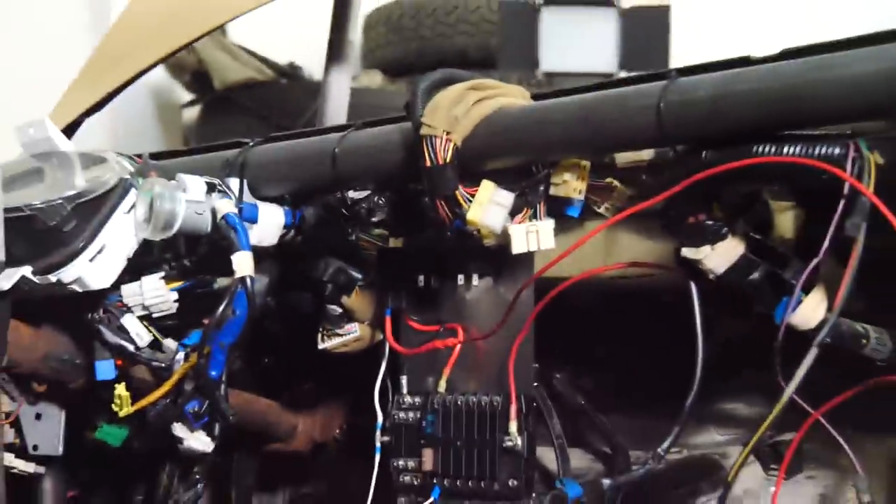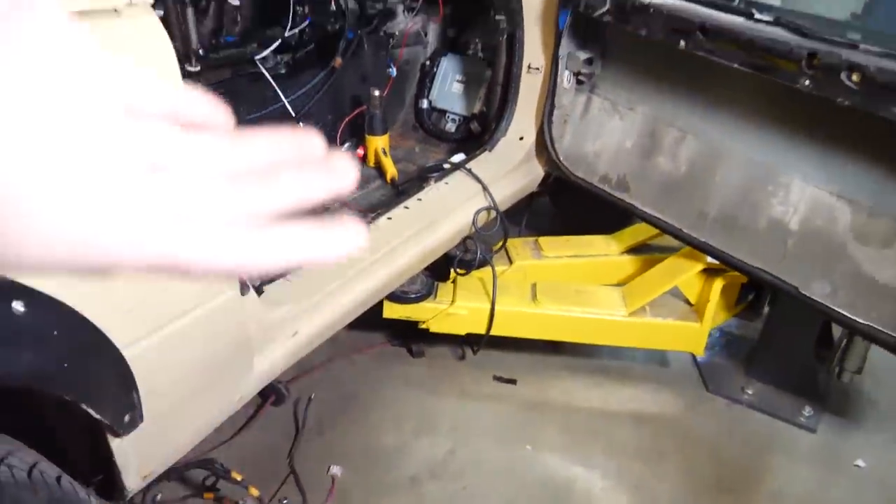Got the fuse panel mounted with relays for the fuel pump, the two fans, and the water pump. I started doing the wiring and then ran out of solder, so that's it for this video. Didn't get everything intended done, but a lot was accomplished — entire engine bay work is done, the radiator is mounted, some lines are done, and the electric water pump is mounted. In the next video we'll finish the cooling system, mount the fans, make a shroud, run the coolant, start the engine, bleed the coolant, and bleed the power steering.